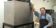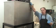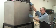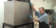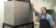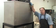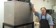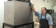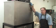We're in Utah here and we are cold outside, and in the winters we start to blend. We make primarily our biodiesel from canola oil. Canola has wonderful cold flow diesel properties, and so when it gets down to about 50 degrees we start blending. Before then we can kind of handle it. Some of our diesels are a little bit more sensitive, others aren't, but pretty much if it's a diesel, it'll handle biodiesel. We'll handle it really well.